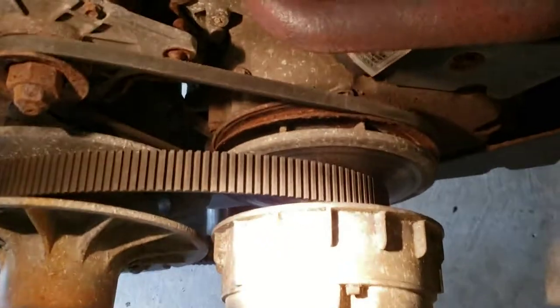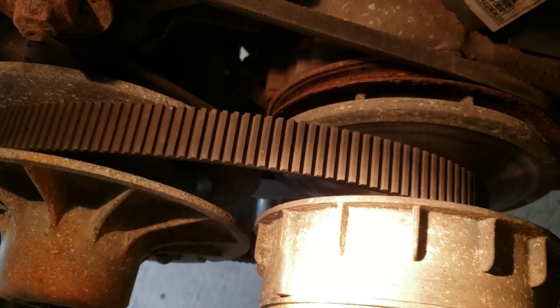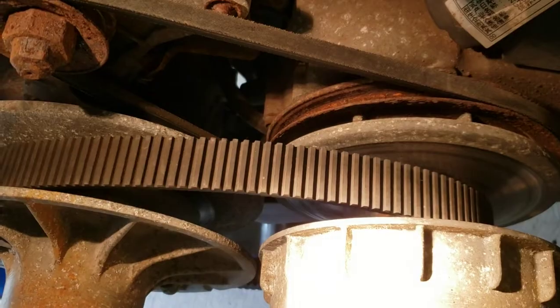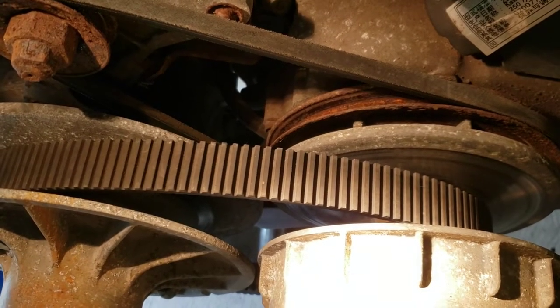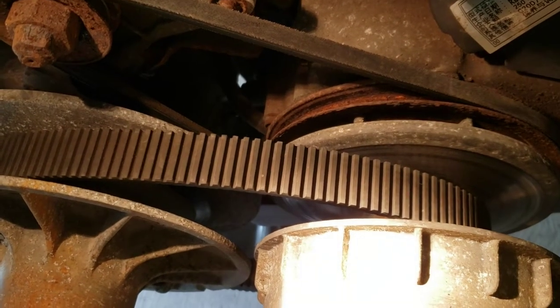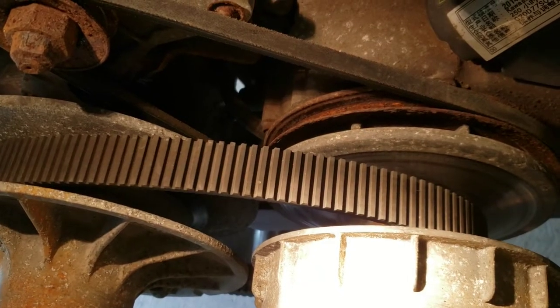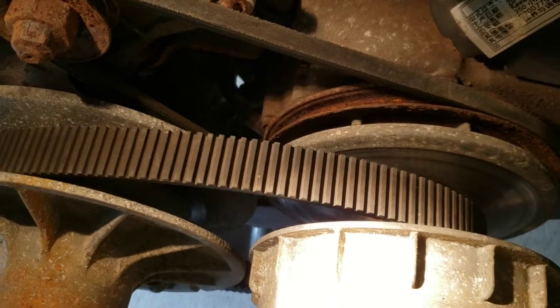And what I think is happening is when I step on the gas, instead of the starter motor being dedicated to spinning the motor up to speed and letting it catch and start running, it's actually struggling to move the golf cart forward at a fairly slow speed, but nonetheless, it's having to propel the cart forward, which wears it down and gives me a lower idle speed.